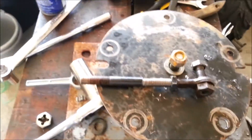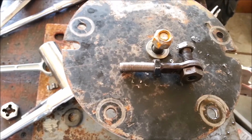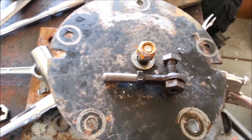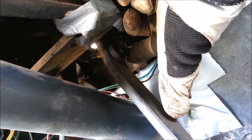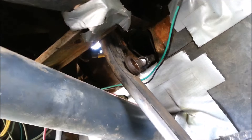So it was this long — I cut it down and re-threaded it. Now I'm going to test fit it to see if, hopefully, I didn't cut it too short. Pretty certain I didn't, but I measured about six times before I made sure. Got it shortened and fit. Now I just need to mark the pedal — I'll probably have to pull the whole pedal assembly off and re-drill a hole. Then I'm going to need to cut those two back brackets off.